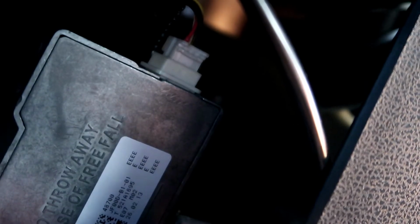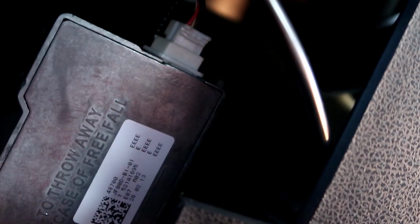But what I did is these wires up here. Let me see if I can get the camera. So what I did is I got these wires up here. There's a pink one. I put a pin in the pink wire, and then I grounded it with a screwdriver up to somewhere up here. And then while you're doing that, try click the start button, and you just want to get into ACC mode. You'll know when it happens because everything unlocks and whatnot, and then the car, you know, does its thing.